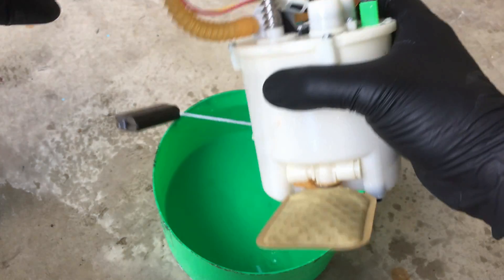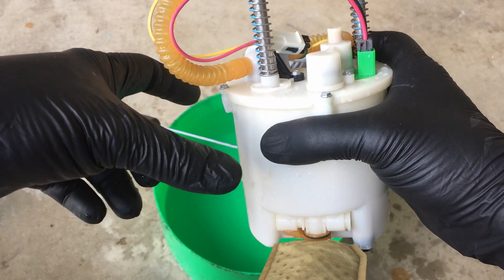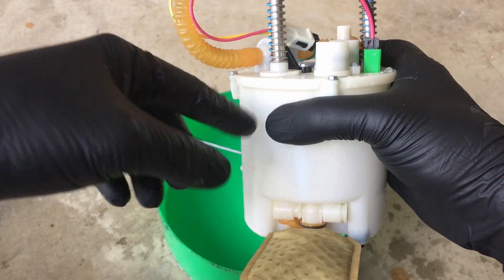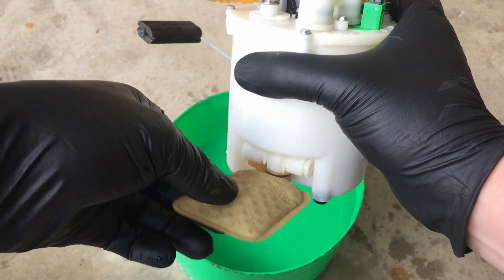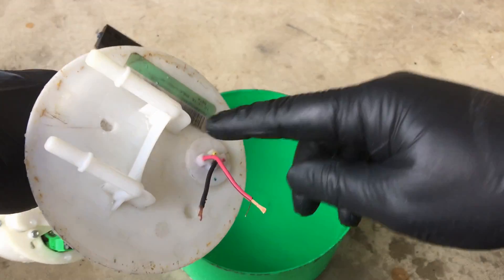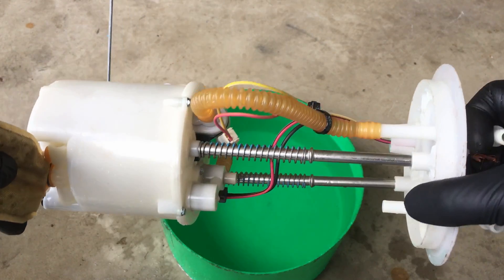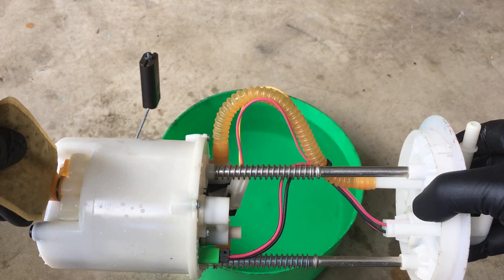Down here, this whole housing contains the fuel pump, some baffles, and a reservoir. As fuel sloshes back and forth in the tank — and a lot of these tanks don't have big baffles — you want a constant source for the fuel pump, so this reservoir fills and stays full at all times. This right here is the actual inlet sock, which screens large debris before it enters to protect the valves and the fuel pump itself before it's sent out to the fuel filter. That's the basic anatomy of these pumps and all the different points that can fail. Hopefully you found this informative and it helps you fix your Ford yourself — see you later!